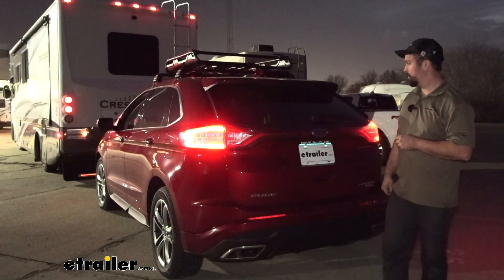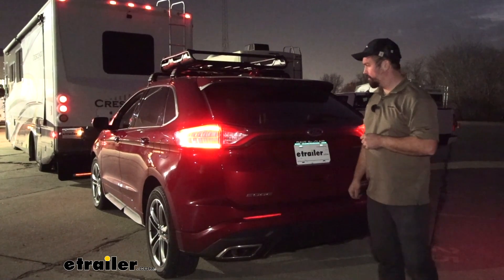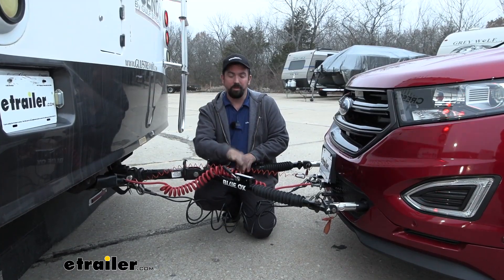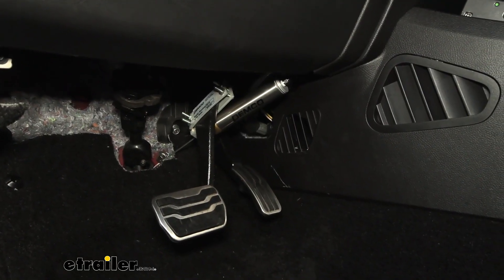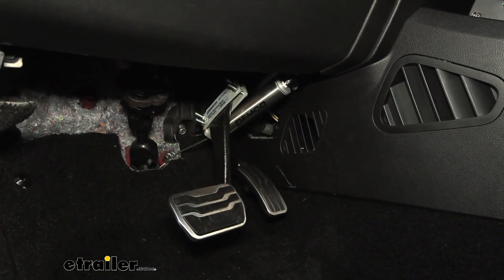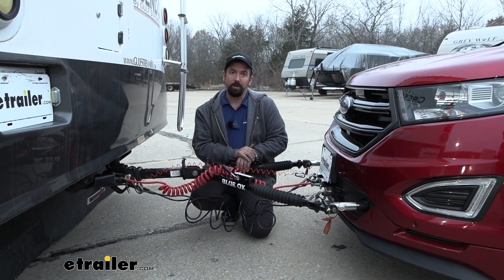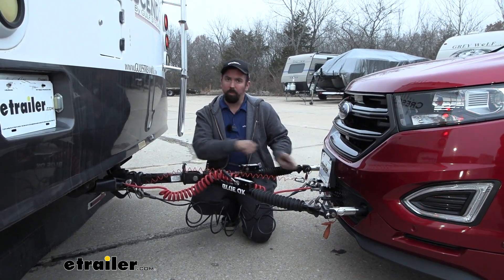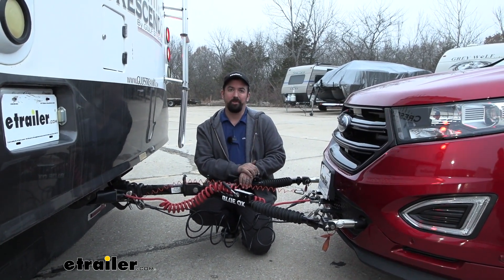We also have our diode wiring, which is going to transmit the signals of your running lights, brake lights, and turn signals to your vehicle — all done via the umbilical. Your braking system is operated by a cylinder mounted on your brake pedal that pulls towards the firewall when you put the brakes on the RV. It also has a breakaway switch, so if everything fails, it will pull that cable and bring the vehicle to a stop so it's not rolling down the highway.